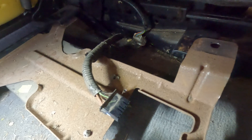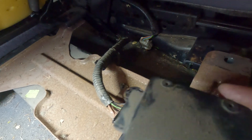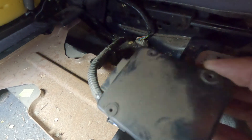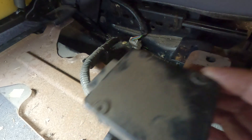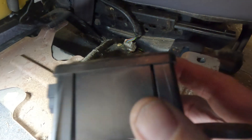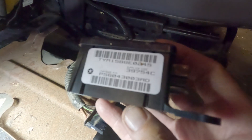I'm not seeing any corrosion on the ends, and you can hear the ball. There's an inertial ball in there and it's supposed to rock around — it rocks around normally, which is bad news for me because I was hoping it was stuck. I'm not seeing anything on the outside of this module that is suspicious.